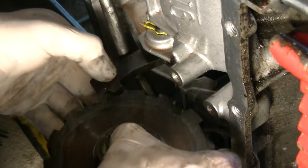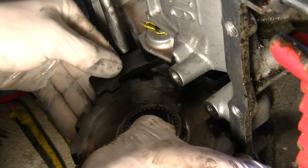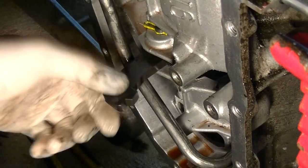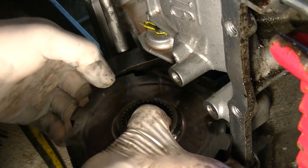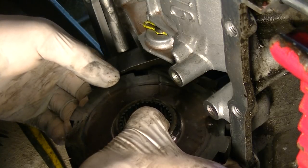This little tooth holding this gear — that's the only thing holding your car when you're in park. So you should always put the emergency brake on as well when you park, especially if you're on a hill. A lot of people don't, so say you're on a hill facing up and you don't have the e-brake on.